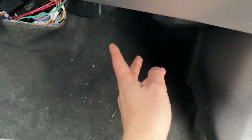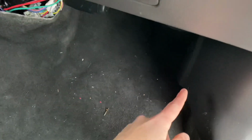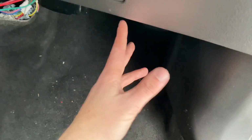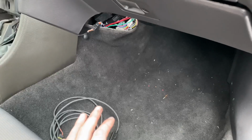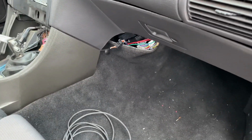So you're going to wire whatever output from your Terminator ECU into that light green and violet wire. In your tuning, you're going to set up a ground output. Whenever the ECU sees a certain coolant temperature, it'll ground that wire out and turn your fan on. So it's pretty simple stuff once you dig into it and get a little bit better understanding of how it all works.